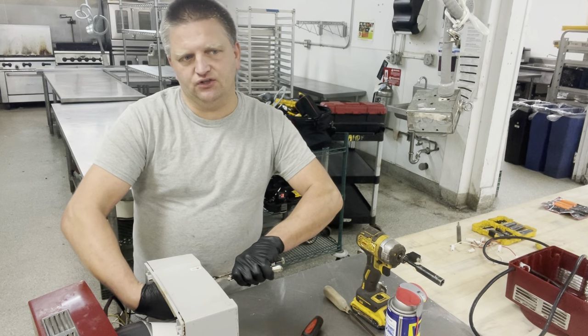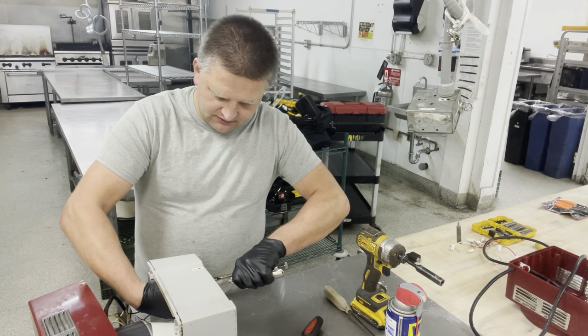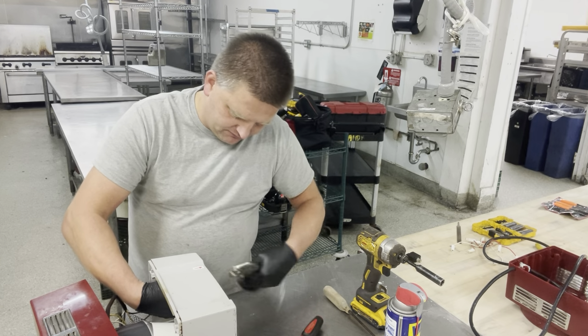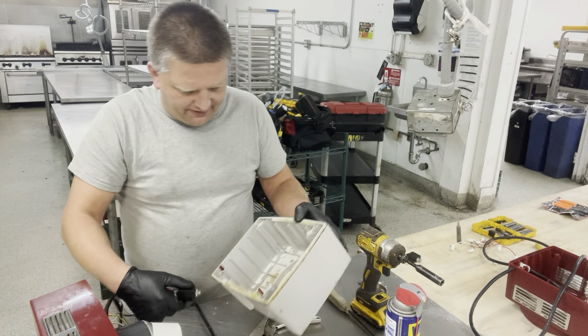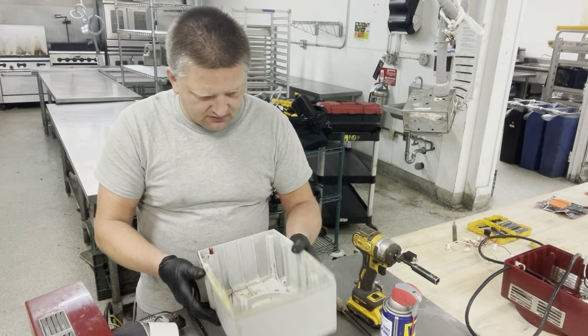your high temperature switch that prevents the motor from burning out, reset button they call it, and slowly turn the nut out, gently remove the nut, and pull it aside. Remove the base, your gray base. Be careful with the screws, don't lose them.